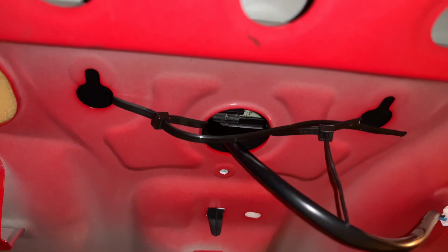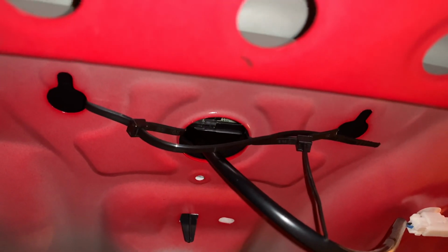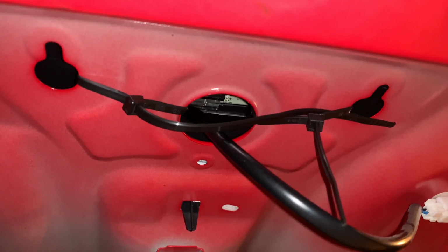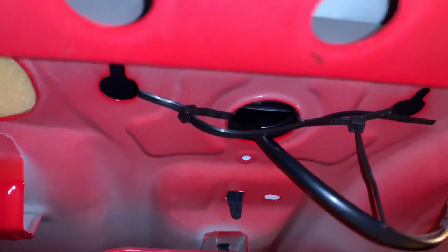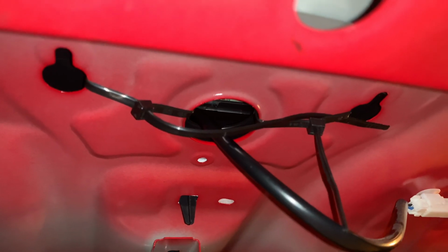if you look here, there's a hole. There's 3 holes, actually. So you go in through the top, you remove the third brake light, it pops right out. You will then have full access to all 3 holes. You'll see it's just the deck that the third brake light sits on, and once it's removed, you could thread zip ties like this. Doesn't have to be too long, maybe like a foot, 10 inches. You could thread them directly through the deck and these holes in the sheet metal.